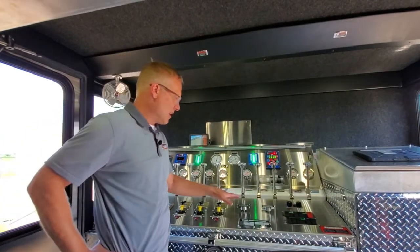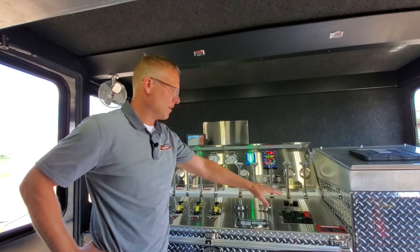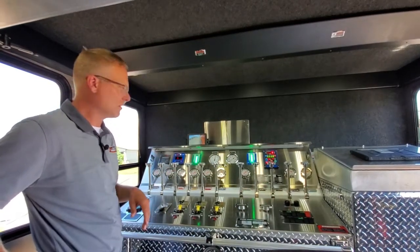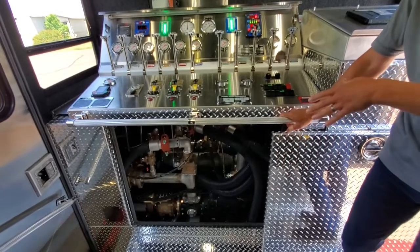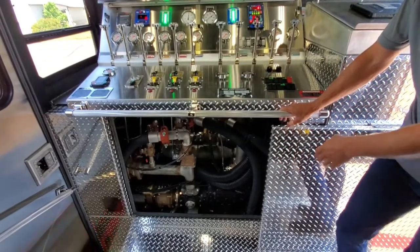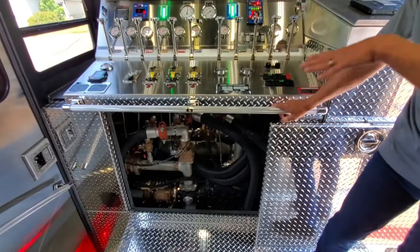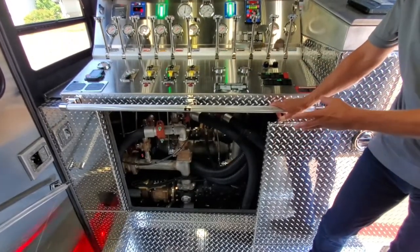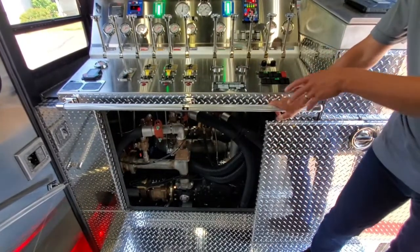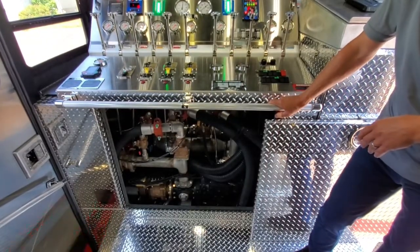The rest of the console has the heat exchanger, pump cooler valve, heat and air conditioning for the crew cab, and then a variety of rocker switches for the scene lighting, the air horn, and pump panel lights. I removed the access door below the pump controls — you can take this door completely out of the cab for more work space. Essentially, you have phenomenal access to the fire pump right from the interior of the crew cab, and you can see the various valves, controls, stainless steel manifolds, and some of the ducting for the heat and air conditioning system.